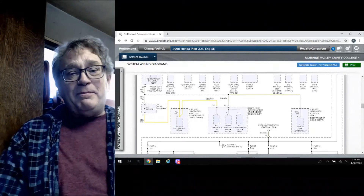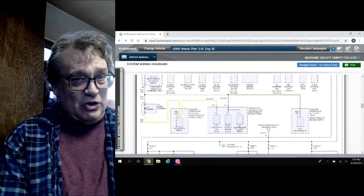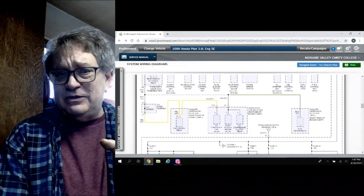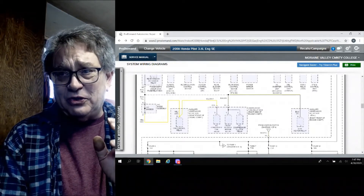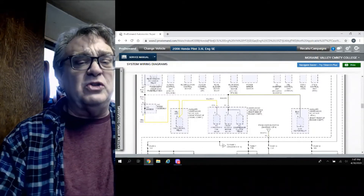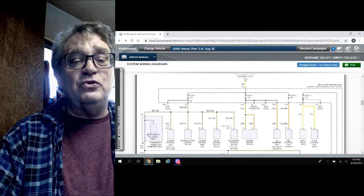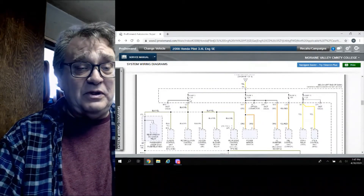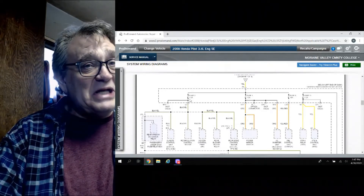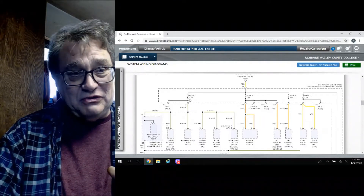So just to recap: just because of what it says on the label doesn't mean that's all that's on the fuse. You really do need professional-level databases to do this. If you put in, say, fuse three — a seven and a half amp fuse — and you put another seven and a half amp in there and it doesn't blow, maybe you're good for a while, but probably not. It's probably going to blow again. Until you know what caused it, you really didn't fix anything.